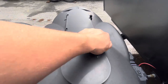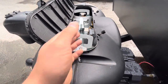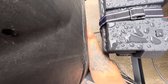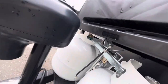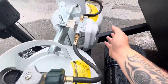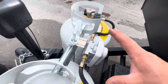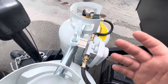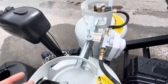You have two 20-pound propane tanks, and this top cover flips up to turn them on and off so you don't have to remove the cover every time. There's a bungee cord underneath that holds the tank, with a tab on each side. The regulator shows an arrow pointing to which tank is drawing. You can have both on, and when one goes empty the valve will automatically switch to the other, but it's recommended to use one tank at a time so you know which is empty and which is full.